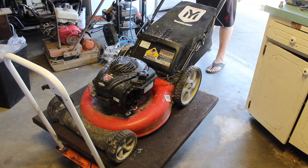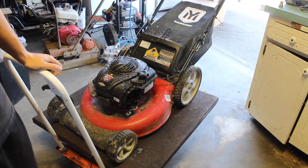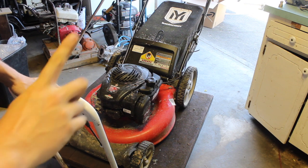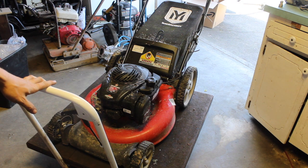Let's see what happens when we do this. Somehow the butterfly flipped sides — usually the opening is facing the engine, but for some weird reason it's facing the other way. Never saw that happen before. So it wasn't getting throttle. Let's try this again.